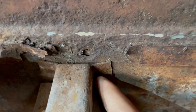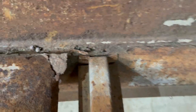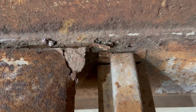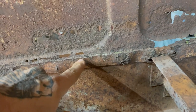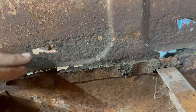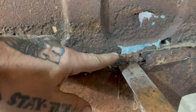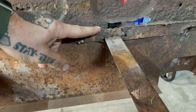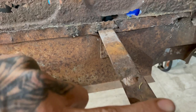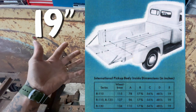The flange is about a half to three-quarter inch flat, so you just cut the channel a little long, then notch and bend it back and weld it in. The steel bed floor rots out here because dirt and moisture pile up — you can see the moisture line. The ribbed floor comes over and ribs down, spot-welded in, then ribs up and down again. This gives the measurement for the depth of the floor, which is also provided in the graphic.